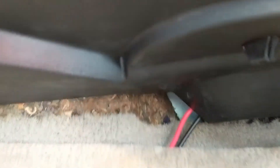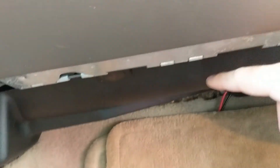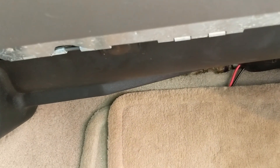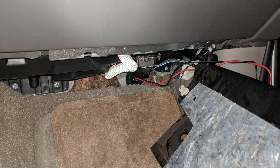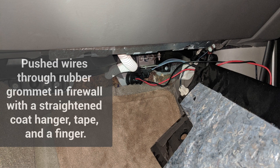Here's the wire that comes down from the grommet — it actually runs under the floor mat there. Then just behind this, there's a panel here. You just pull a couple of plastic thumb screws out, and then there's one little piece you have to pinch. Once you pinch that and drop it down, you've got access to everything back here. So I just ran the wires to the battery.